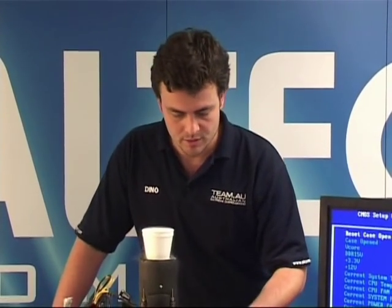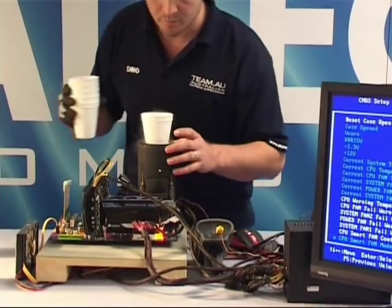Some of the components that we're using: we've got a GIGABYTE X48T-DQ6 motherboard, which is a DDR3 version of the motherboard. We're using Corsair 1800 MHz CAS7 memory, so latency is 7-7-7-20, 1T at 2 volts. We're using an NVIDIA 9800 GTX graphics card, and an Intel E8500 CPU. It's a 45 nanometer dual core CPU. The temperature currently is minus 76 on the temp probe. Get some more.